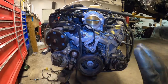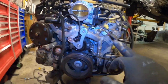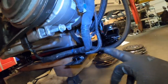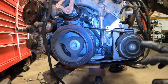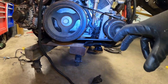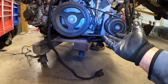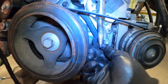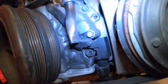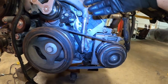There's one other very important thing I wanted to distinguish before we put this drivetrain in, and I needed to explain it to you, and that is this coolant passage outlet. Now this passage actually goes down and into the old existing oil pan oil cooler. The oil cooler was right on the oil pan. There was no external cooler sitting in front of the engine for airflow. It was actually attached to the old oil pan. Since we went to a Holley oil pan, which is a slimmer fit, we actually need to plug this up now. So this guy is just sitting in here with a little circlip, and we crimped it and welded it closed so that the coolant does not flow anywhere. And if you forget to do that, you're gonna fill this up with coolant and it's gonna start pouring out.